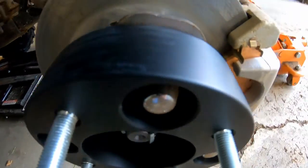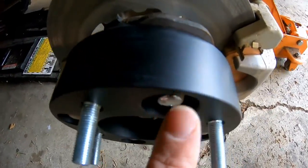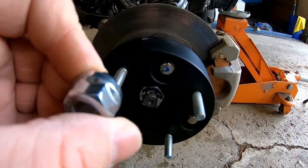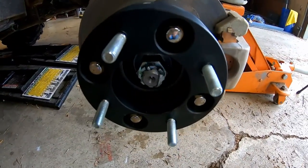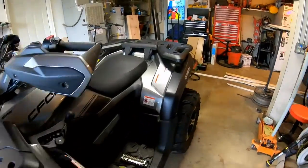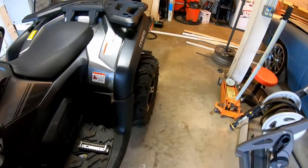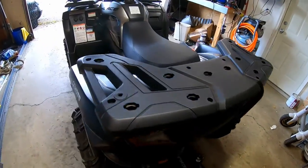To show you what I'm talking about: the factory lug nuts go on the wheels here and don't protrude outside because it's an inch and a half spacer, so there's plenty of room. The spacer bolts are about an inch and a quarter longer — I just need to get new lug nuts and we'll be good to go. Now it looks way cooler, got a little more stance, a little bit wider. Hopefully it doesn't get too muddy since the tires stick out a bit past the fenders, but for what I need it's worth it.